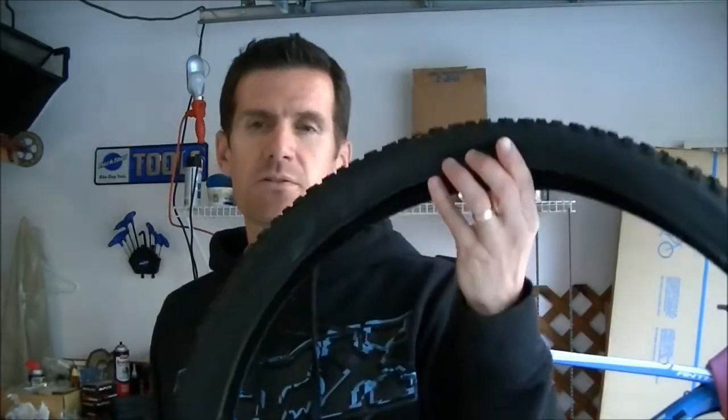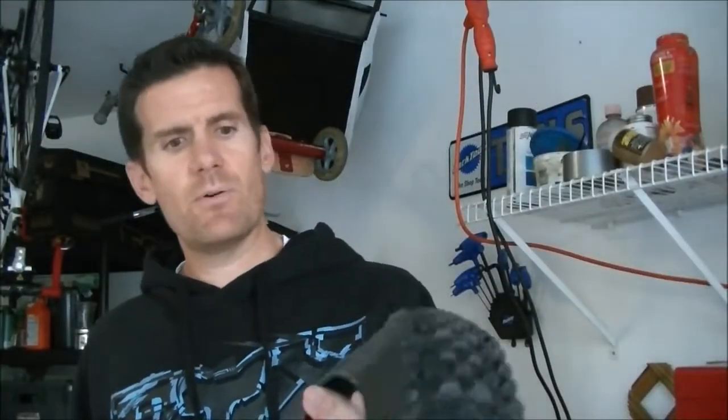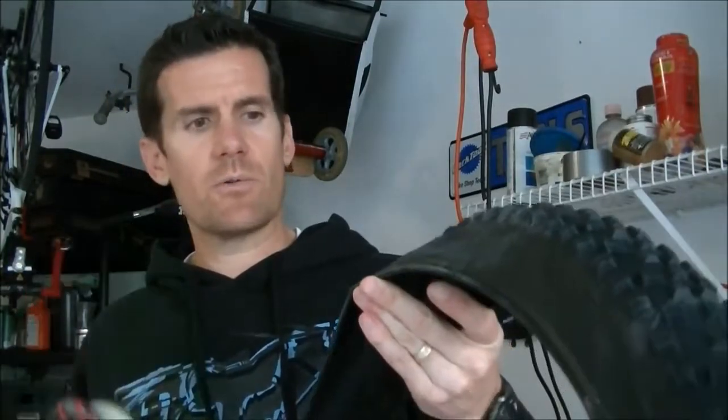In this video, I'm going to show you how to mount a standard tire onto a tubeless rim using Stan's fluid. Okay, your first step is to put one bead onto the rim. The bead is this edge around the tire. So all you need to do at first is to put one side on.